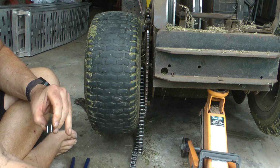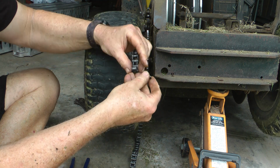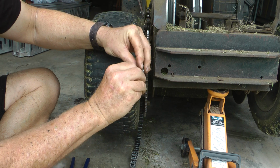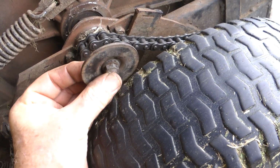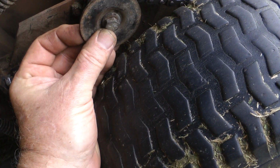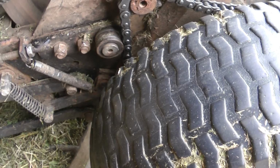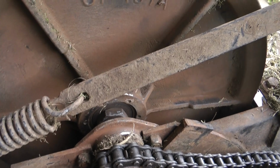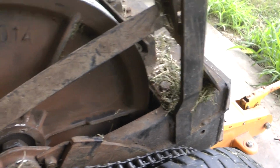Here's our new coupler. Now I'm going to put it this way on this one because I had it on the inside, but I suppose if it's outside it doesn't matter. Might protect it a bit. Okay, to actually fit the chain, take this retainer off that sits covering your top cog here. You just hold the back cog there, put a shifter on the back here, stop it from spinning, because that'll spin if you try and do it without holding.